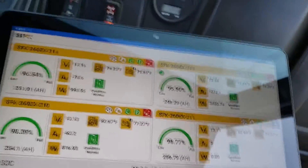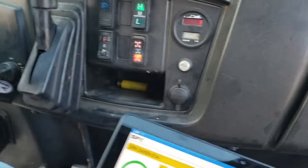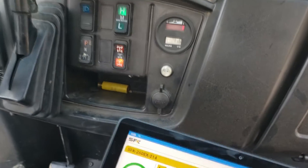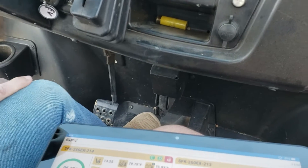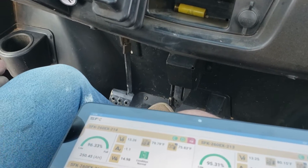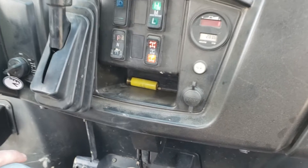I'm seeing 110, 120. You've got a governor on there, so there's no way you'd be drawing that much — even though it's a 30-horsepower motor. The lead acid would just puke their guts out. Now you can run like that for hours. If you go wide open for a long time, the wiring to your contactor might not handle it because it's not used to pulling so many amps. But it'll definitely get you out of ruts. You can putt around at medium speed, high range for quite a while.